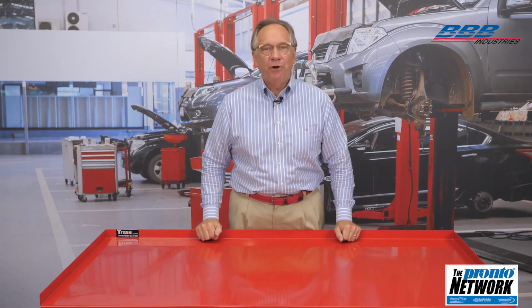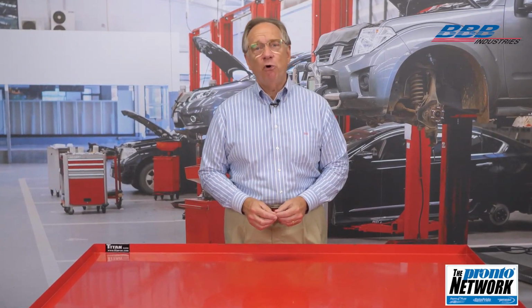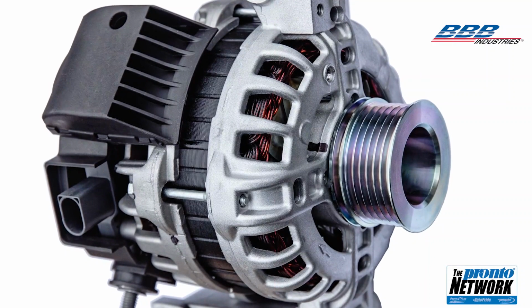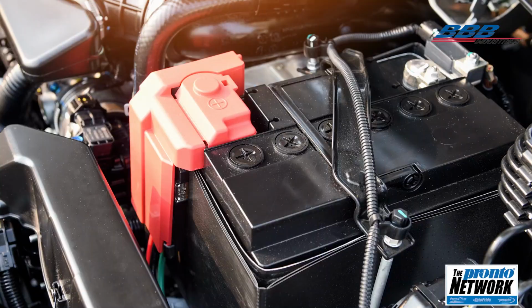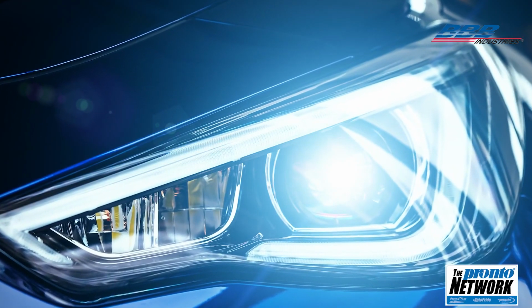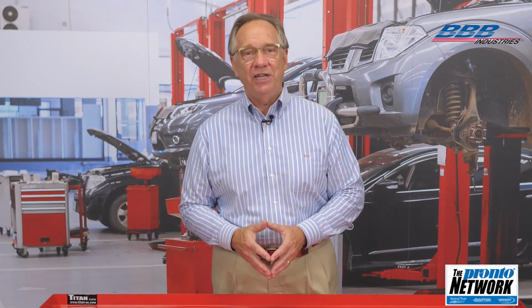There's not much more frustrating for a service advisor or your customer than not being able to explain why vehicle components are failing. When it comes to diagnosing rotating electrical assemblies, there's a lot more than meets the eye. One reason why alternators have a high failure rate is because they're always working under a load, generating electricity to recharge the battery, run the fuel pump, injectors and ignition system, and power all of the vehicle's lights and other electrical accessories. This places a substantial load on the alternator, generating a lot of internal heat.